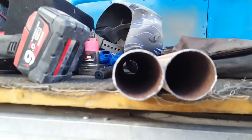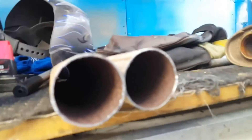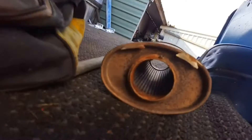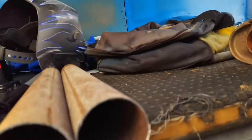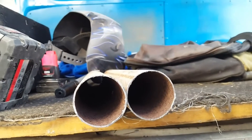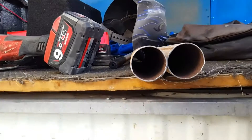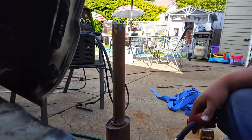We're now going to run from there into a bit of two-inch mild steel pipe, throw a two-and-a-quarter-inch straight-through muffler on, then a bit more two-inch pipe, and then we'll sort out a tip for out the back. Let's get these cleaned up and we'll go from there.